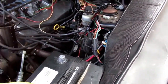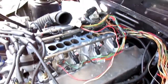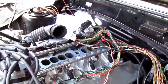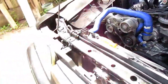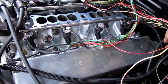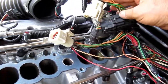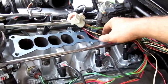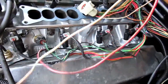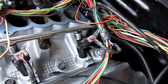I wanted to do a little update — show you some wires I'm removing and why, so you can do it yourself if you need to. It looks complicated, but let me show you what's going on. I removed the upper intake manifold. These are called the salt and pepper shakers — also known as 10-pin connectors. In this connector right here I'm going to remove two wires that used to run under the intake manifold. I don't want them; all I want are the four fuel injection wires.